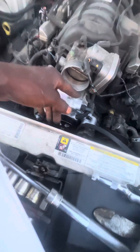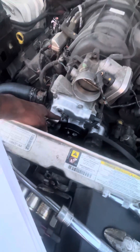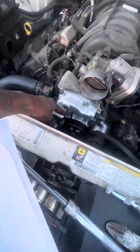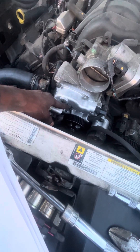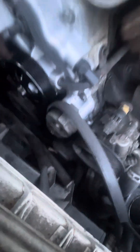It's going to pop out right there. Check that seal — make sure that seal isn't broken or you're going to have a leak. After you do that, this here is a 16mm bolt. I like to do that one last. Then there's a 15mm bolt on your tensioner pulley, and you'll have a pulley right here which is a 13mm bolt.